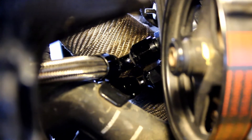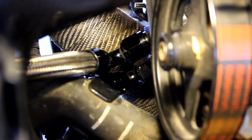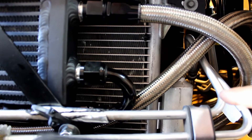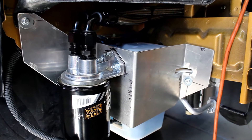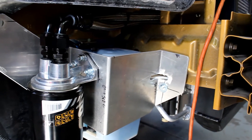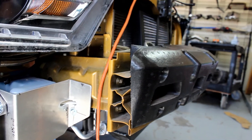Down at the bottom we have a 45-degree and a 90-degree fitting — the outside connection is the output, and the center connector is the input to the motor. Those come out and go to the front. The input to the engine is the top straight one that goes back into the motor — that's the cold oil. The 180-degree goes to the oil filter housing. Hot, dirty oil comes from the motor all the way under the cooler into the filter, out of the filter back into the bottom of the oil cooler, then it's pushed through the cooler and back into the motor.